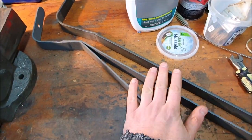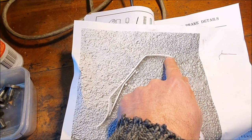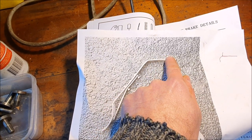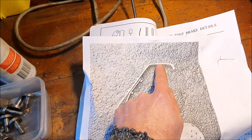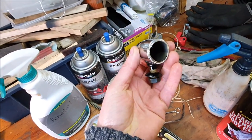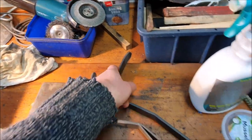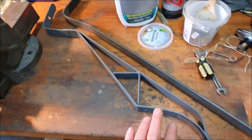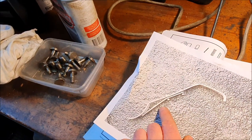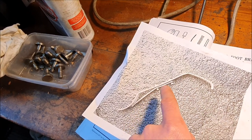This is five millimeter thick steel and I'm going to make them more Austin pattern, which is more this sort of shape. On the Austin guards it's actually screwed through the side, but because the way I've done my guards, the very top of the guard is where this bracket is, which means I can actually mount it through the top. I'm going to mount it with these little side lights, which I need to finish restoring, and they'll sit through the top of the bracket and they are level, which is good. I'm going to do the same here - that light will mount through there - and I'm going to finish making up these in two pieces that bolt together like this Austin example. I think bolting them together is better because these things are going to vibrate no matter what and any sort of welded joint is likely to crack.